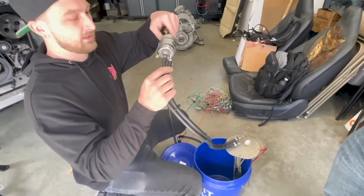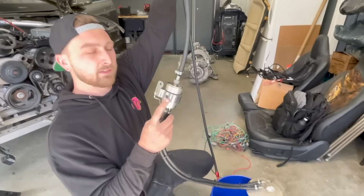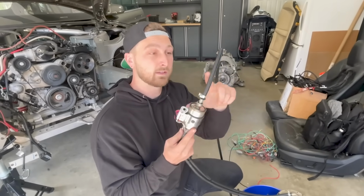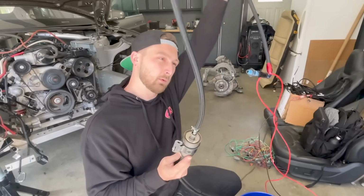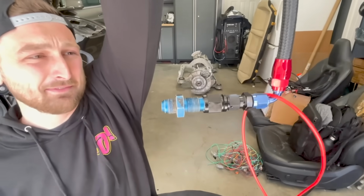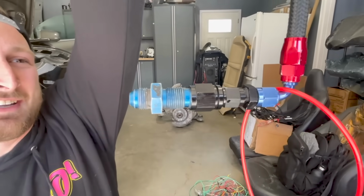Corvette fuel filter, because it's nice. It's a filter and regulator in one. This regulates the fuel pressure and only has one line out, so we only have to have a feed going to the rail. Then we had this converted up to Dash 8 with random fittings I found. Yes, there's a lot of adapters there. That's fine.